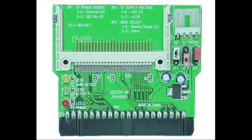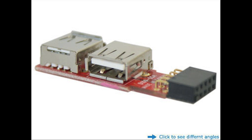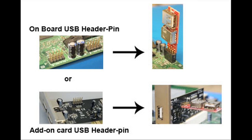Hard drives, check. In addition to that, what we didn't cover there was getting your storage medium. It's a pain to partition your RAID array to hold the FreeNAS install. You're better off going with either a CF card or a USB stick. There's an issue with CF cards, though: if you go with a low-end CF card, they usually don't have DMA support, and the adapter card has to support DMA as well. If one of those doesn't support DMA, then you get into an issue with FreeNAS. Ragble got into this issue. Everybody else, just get a USB stick. But you can get a USB header pin that goes on the motherboard, so you can keep your flash stick on the inside, so some toddler doesn't come by and yank your stick and you've just lost your config.